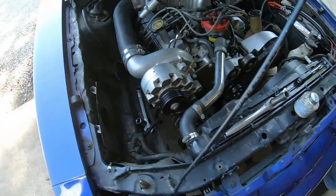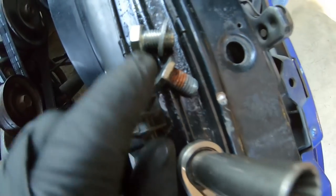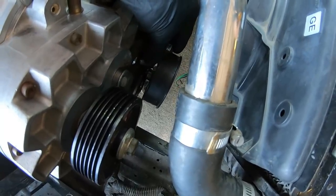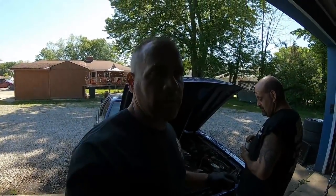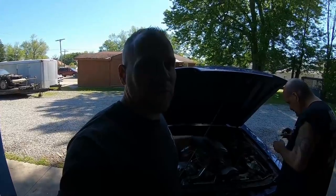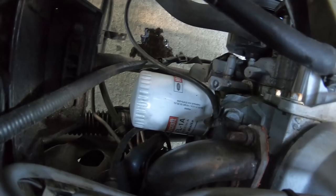This tensioner is a little pain in the ass and it's hard to video and install at the same time. They actually physically have a thinner headed bolt — you can tell the previous owner obviously didn't have it all the way seated, so I've got to clean the threads up. It goes behind this pulley, which makes no sense. You have to put it in finger tight, then tighten the pulley down, then set the belt with it loose until you get the other two tight.